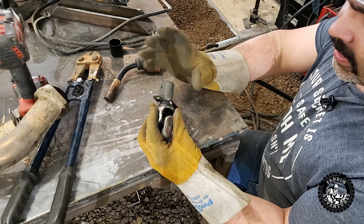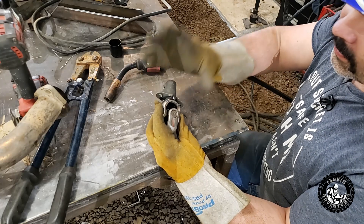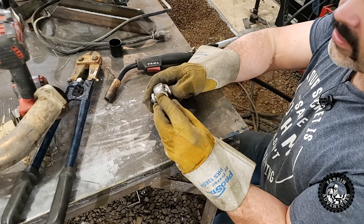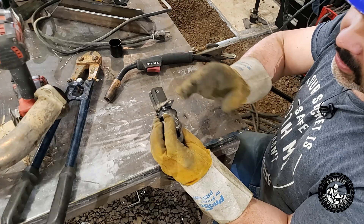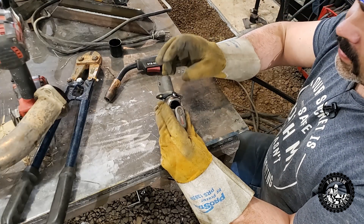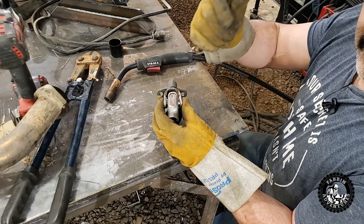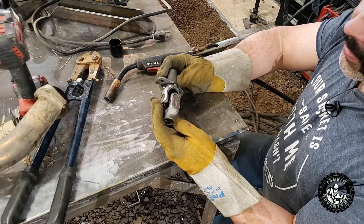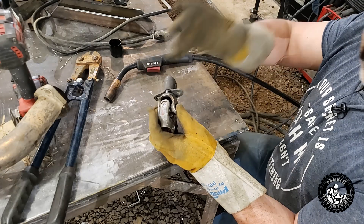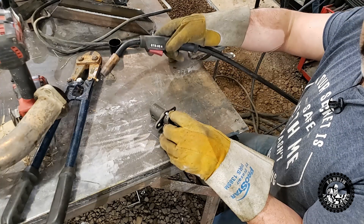What I opted to do here was take the original rag-joint mount that goes onto your steering box — I took that off the steering box, cut this U-joint down, and left the splines that attach to the motor. I cut it down, made it all square, lined it up so it's perfectly in line, and I'm going to weld this. The reason I'm doing it this way instead of using the rag joint and welding that shaft onto the motor is I don't want to cook the seals or anything electrical. It's like a rag-joint eliminator — you don't have that rag joint that could fail. This stuff is going to turn harder with more force, and there's a chance you could tear that rag joint, so that's my reasoning.